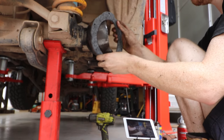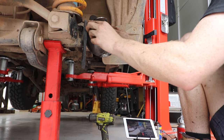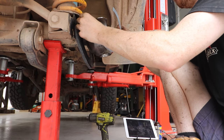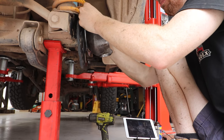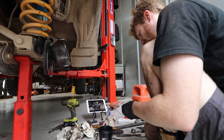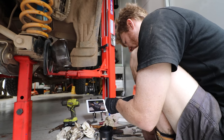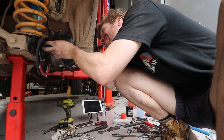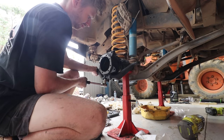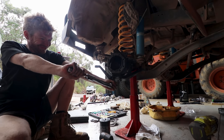I've been going off the iPad pretty much the entire time, because I found the visual aid the most useful for pre-assembly. There are usually specific orders of how things are put together, and certain tricks to get certain items on - for example, that split ring. Using the iPad made it a lot easier. Next was to pack the wheel bearing using the Penrite molly grease, and it's very important to make sure everything is torqued to the correct specification as stated in the factory service manual.